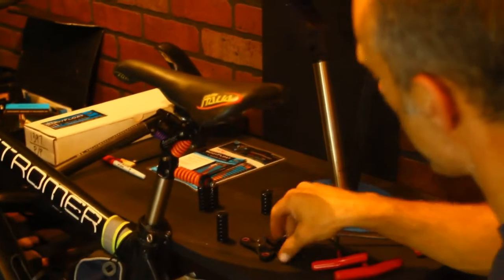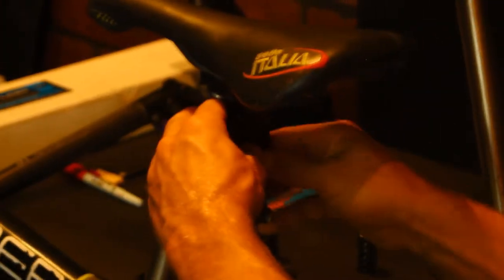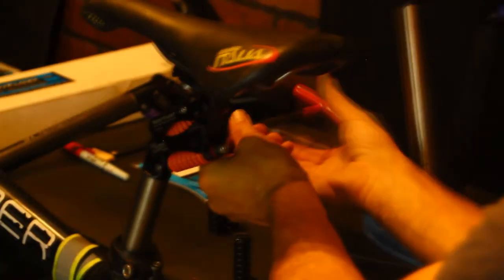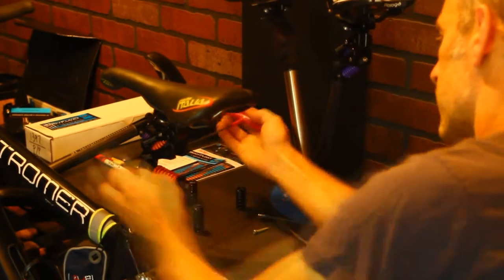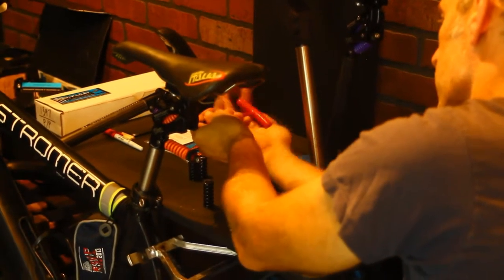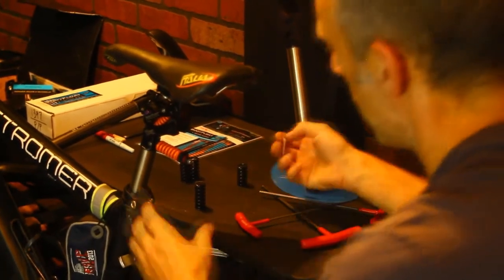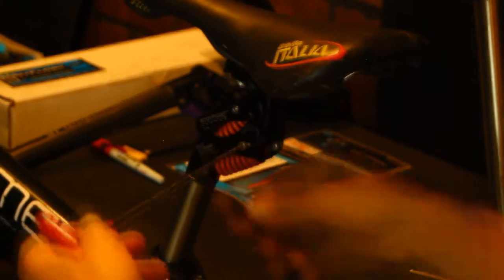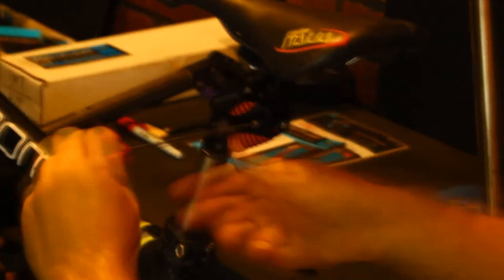Now line up your wings. I've got to put my side links on. I'm lining up my upper pins, give it a little tap on that side, one with my markings, line it up, tap it on there — very simple to do. Press that up into place. Gently tighten up my right side nut. Lining up the left side, pressing up with my thumb and forefingers so I can line that hole up to get that screw all the way in. Give a little bit of pressure to get the thread started.